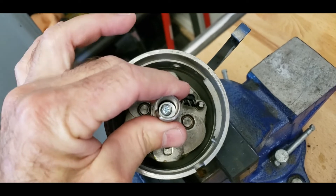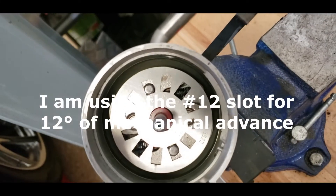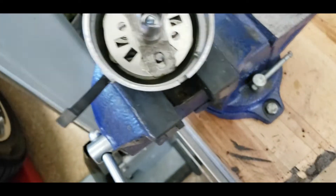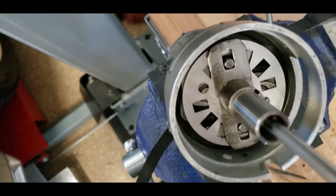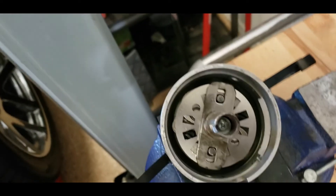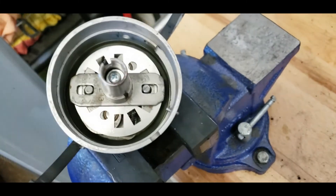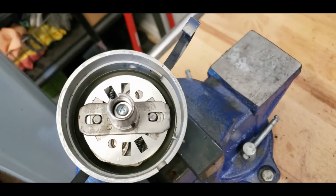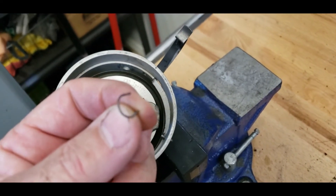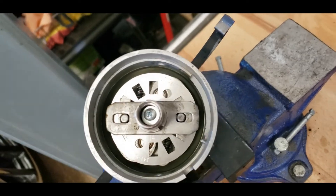There's a little bit of play, pretty much like the factory had, but to get this out to make adjustments to your springs, your plate, or whatever you want to do is so much easier now. I've got my plate on the number 12 slot. The T-bar will go right in over it, then tighten down the screw. Before there was no way I could get this in and out with the distributor down in the car — you had to try screwdrivers, needle nose pliers, all different kinds of cuss words trying to get that thing out and then back in. That's all gone if you do this mod.